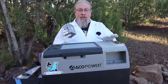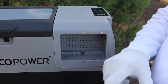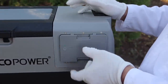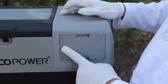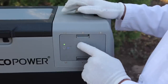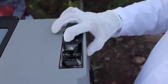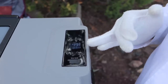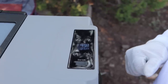Let's plug the battery in. You make sure the posts are down - that's the downside of the battery. Put it in, push it all the way on, squeeze and push until it clicks. Hold the power button down to turn on - you hear it beep. Then hold down the power button on the fridge and the display shows the current temperature, battery state, voltage, eco mode, Bluetooth, and battery level all in one place.